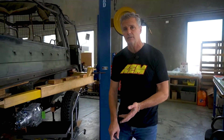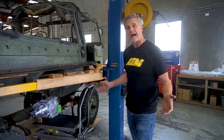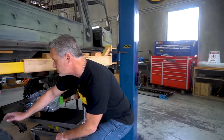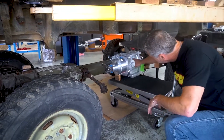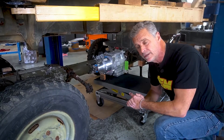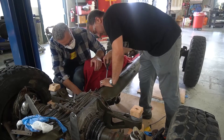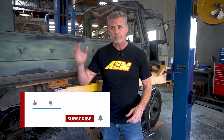One other thing I just want to show — because of Mitch Terry and the work he's done with off-road racing, land speed, road race, name it — we have some concerns about the motor location, and in the event of something really bad happening, like getting T-boned, we want to protect the motor, the high voltage environment, and the fuel tank. So we're actually going to be running some roll cage tubing from mount to mount between the motor and the fuel cell, using the factory chassis mounts, and we're going to capitalize on this beast right here as well. In the event something does hit on the side, everything that's outside is incredibly rigid and will protect everything from a decent sized impact. Safety, safety, safety — we're trying to incorporate it every step of the way. I suspect by the next one we'll have the motor, batteries, and Gen Set fully mounted up. If you like what you saw, hit like, make comments down below, and if you want to subscribe, hit the bell so you get the notification.